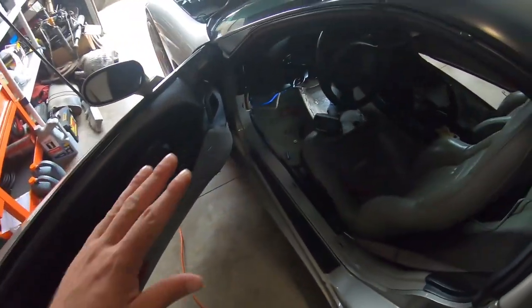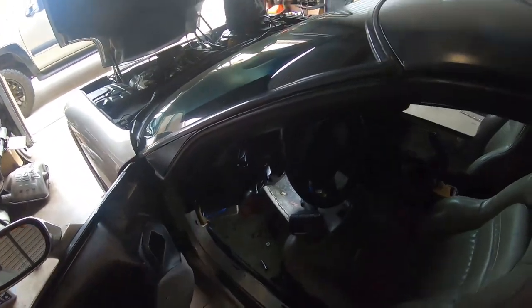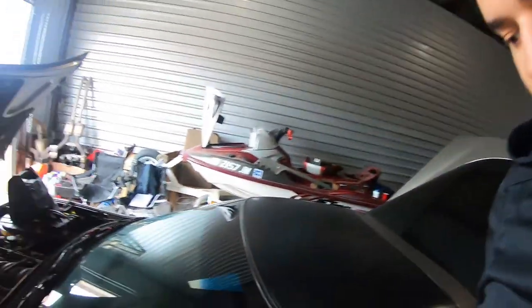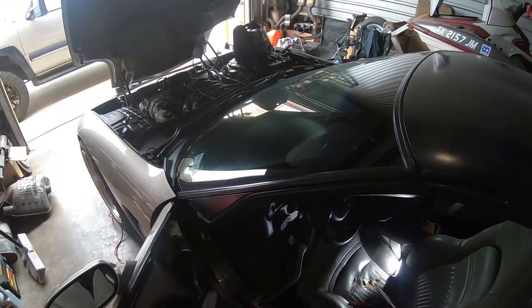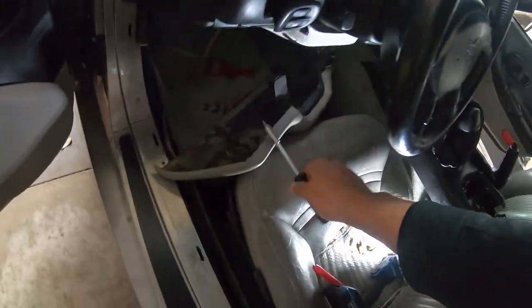All right, so we're back again, and in this update, we've ran all of our RCA cables. The best way to run them is you're gonna wanna drop this panel. There's gonna be 2 screw holes, 1 on each side, and excuse me, I said star bit. This is actually a T10 Torx bit. For all your screws in the dash, it's gonna be a T10 Torx bit. There's gonna be 2 on the bottom. Drop those out first, and then just pull from the top area.